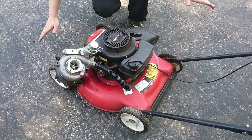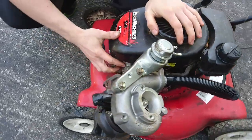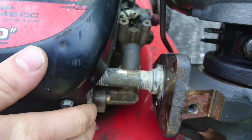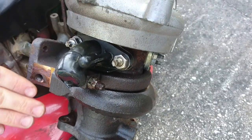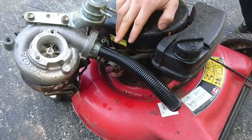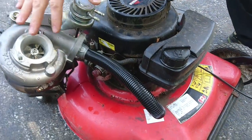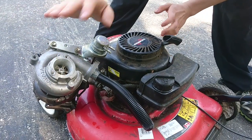Here is the final product — the turbocharged lawnmower is completed. A quick rundown: on this side we have our exhaust manifold, a three-quarter inch piece of piping going straight into the turbocharger. I've added gasket sealer to hopefully maximize pressure from this small 148cc motor. The oil ports are blocked off with a little oil inside, though most of it looks like it leaked out. For charge piping we have this piece of conduit — it won't last long because it may melt, but it looks airtight. This here is the internal wastegate, which monitors how much air pressure the turbo sends in before venting excess pressure.